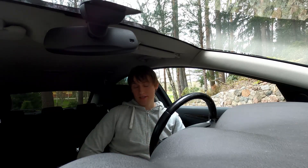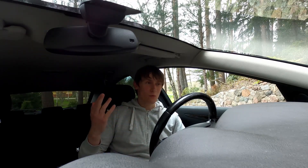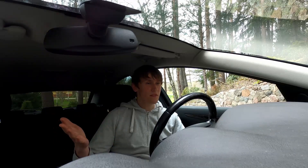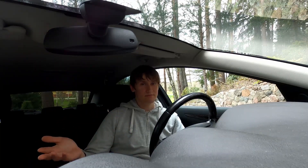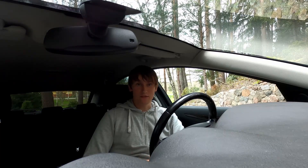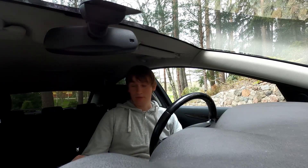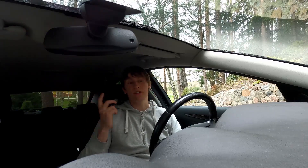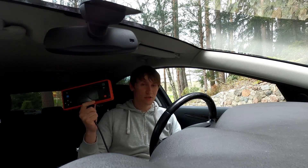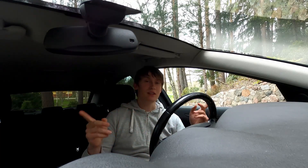The reason I thought there would be more is because I usually get four issues — the two you saw here, and then one for the front suspension and one for traction control. I usually just clear them but they come back after a year or so. But it's nothing serious, I hope. So as you can see, there's quite a difference from zero issues to two issues. I think this tool will only show you fault codes if they trigger the check engine light, whereas this advanced one will show you all fault codes no matter how small. In fact, when I scanned my Ford around four months ago, it even showed that my Ford's puddle lights weren't working.